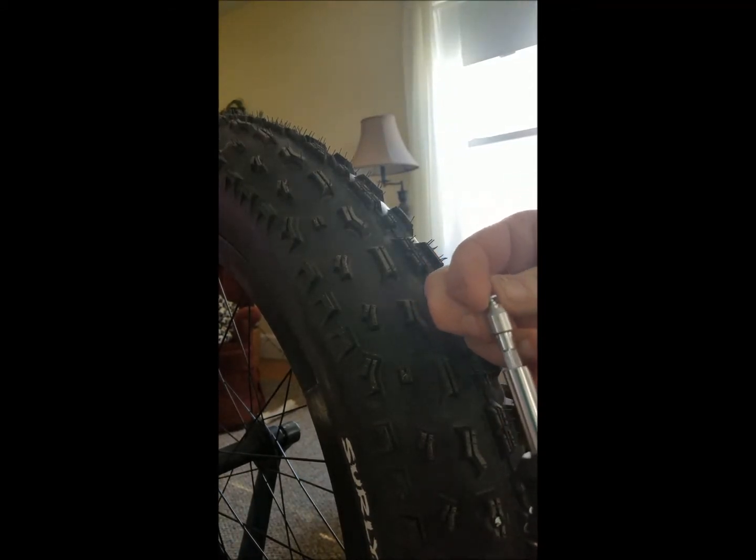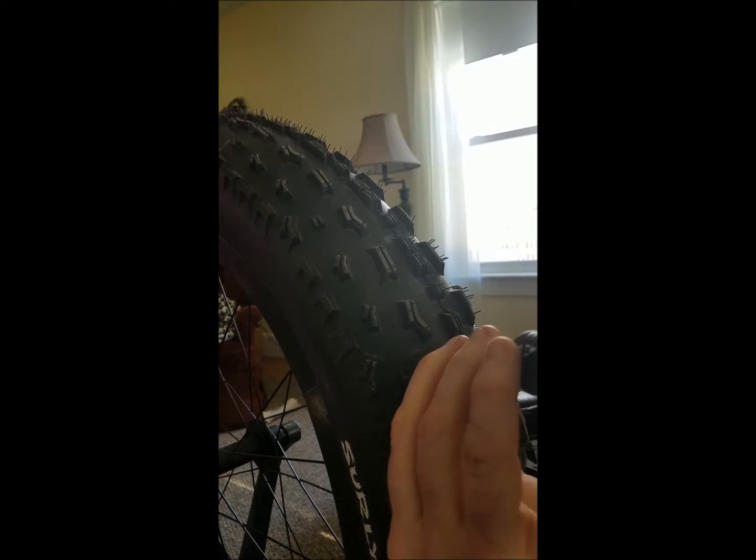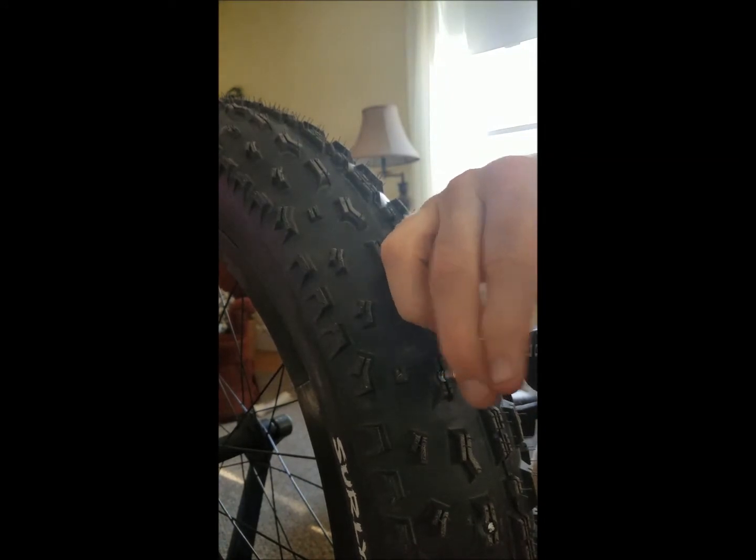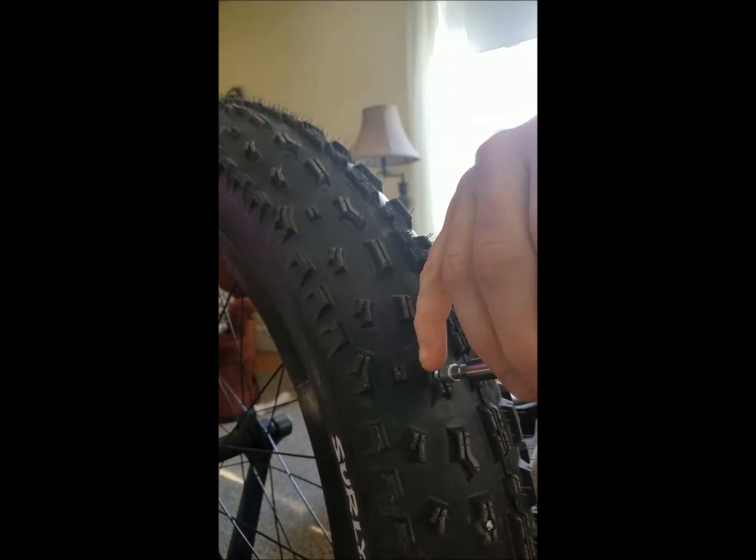The manual would be just taking the stud and putting it into the tool. Establish it in the tread lug. Give it a little bit of pressure here just to kind of seat it, then just give it some turning. Establish how deep you want to put your stud in. Like that, and there you go for the screwdriver version.